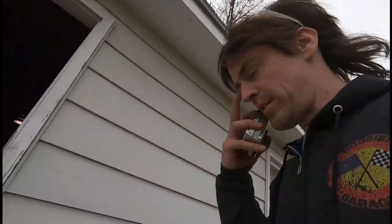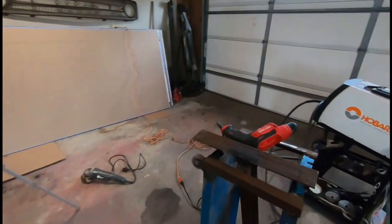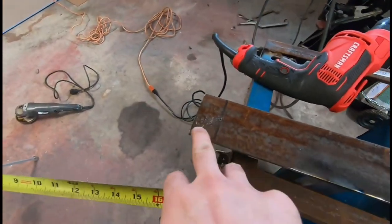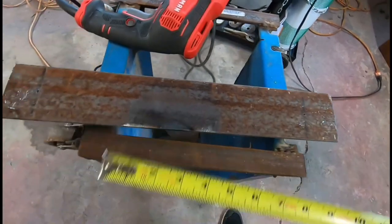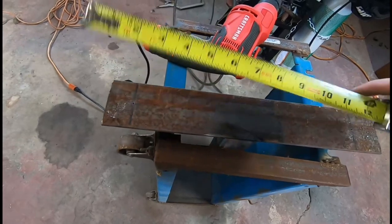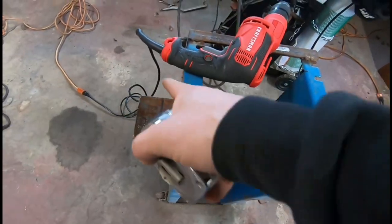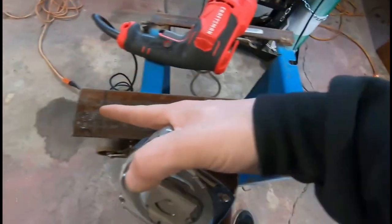You know, we got the 15 inch piece, so you come in about an inch and a quarter off one end. You know you're in the safe zone there, unless you really want to center it, you can figure that out. A little shallower here than it is here. But I came in and then measured it, took a straight edge off this side, like our framer square, marked it, found center of this one, marked it this way and that way.